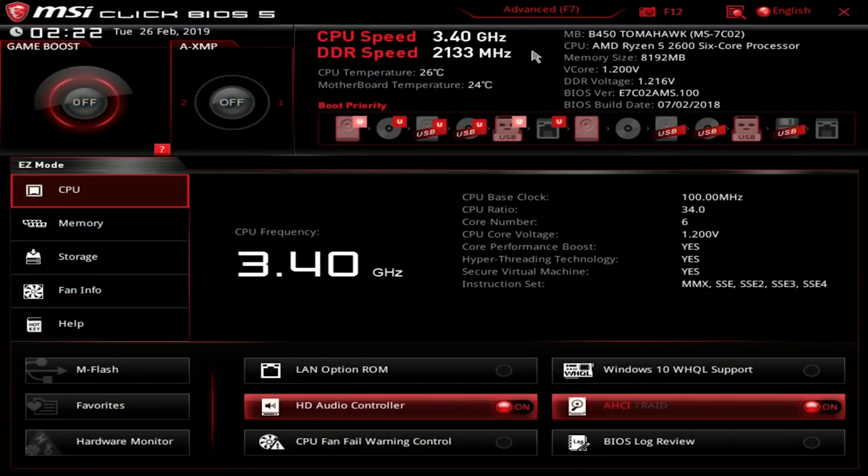As the system is booting up, I'm just going to tap the Delete button once every second or two, and that should allow me to access the UEFI BIOS. This is MSI — it's got a graphical user interface so you can use your mouse to navigate around and click on different things. The first thing I always do is a reality check to make sure that everything you installed is actually there and functional. We can see the motherboard listed — B450 Tomahawk. Our CPU is the Ryzen 5 2600. Memory installed is 8 gigs, which reminds me I installed an 8 gig kit rather than the 16 gig kit that was recommended — I'll fix that in just a second.